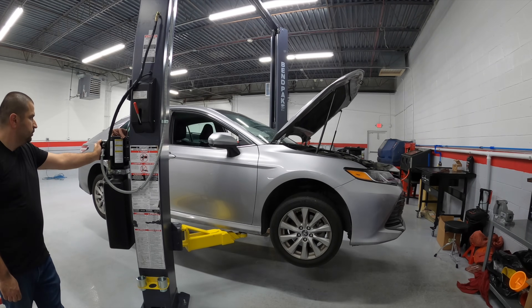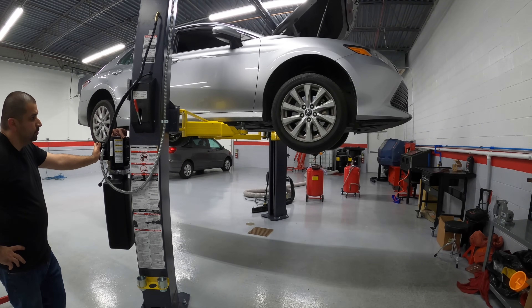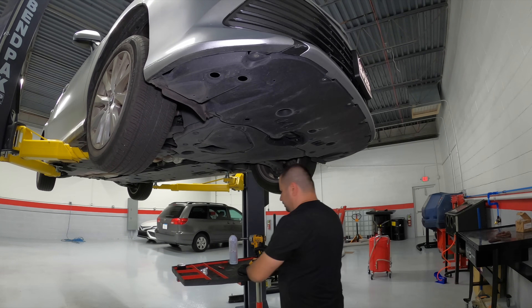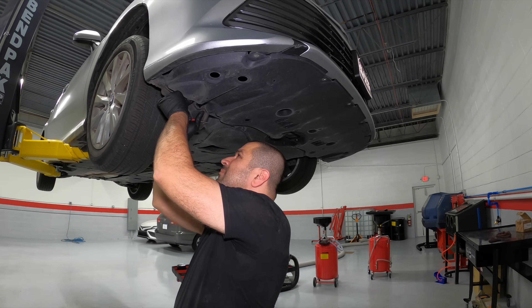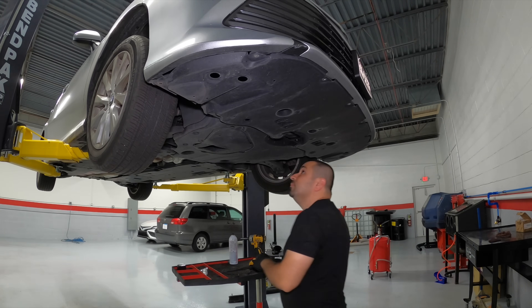You're going to want to lift the car up because these new cars have a lot of covers. You can just use ramps, jack stands — whatever — just do it safely. These covers have a lot of bolts and clips; any clips that break, do replace them. Take your time, take pictures if this is not something you've done before. You cannot access the radiator without removing this huge cover, otherwise it becomes really cumbersome.